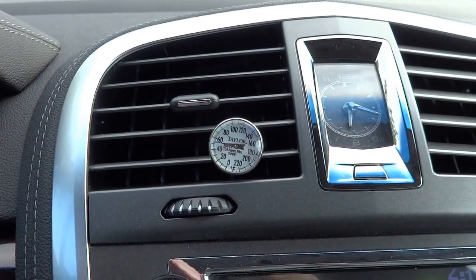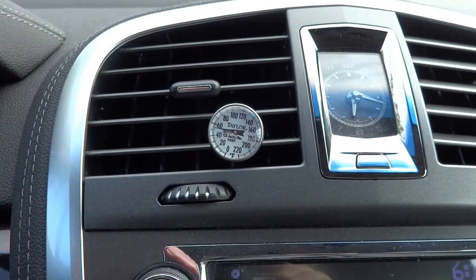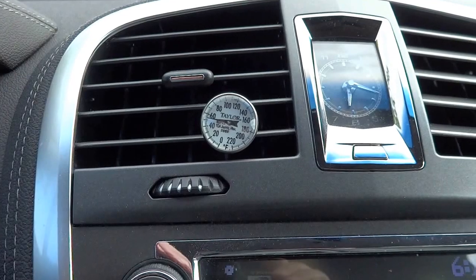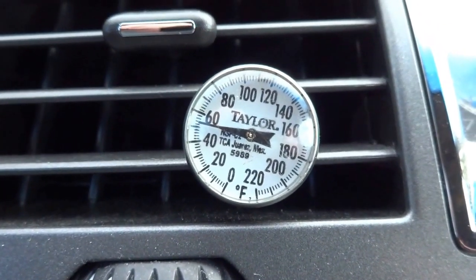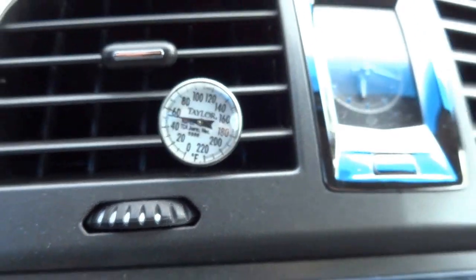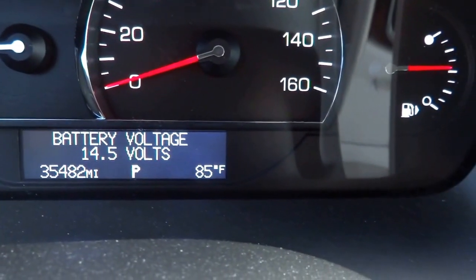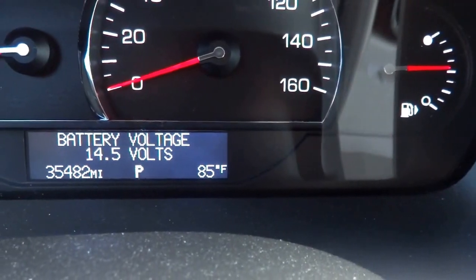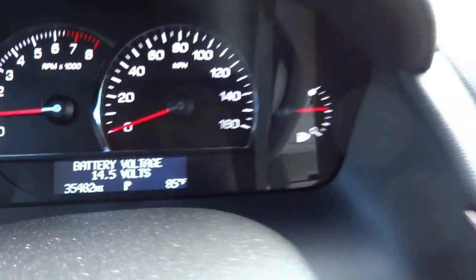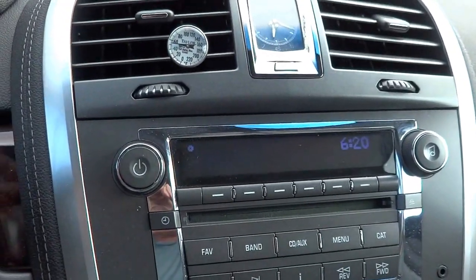I bought this car new so I've never touched the air conditioner. It's about five years old — I had pressure gauges on it, it's a little bit low, nothing major. We have a temperature reading of about 50. This is Florida, and let me see if I can zoom in — today's ambient temperature is 85 degrees Fahrenheit, so the air conditioner could do a little better, but I'm probably not going to go ahead and recharge it at this point.